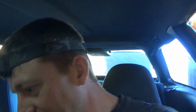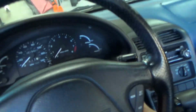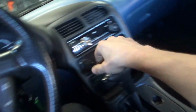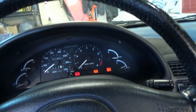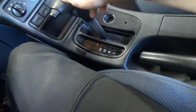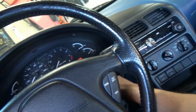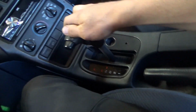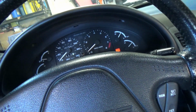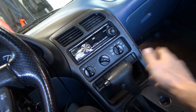And then it got so bad. Let's start it up and put it in gear. And it doesn't want to crank in park anymore. I don't know. In neutral, it's fine. I'll let it warm up a little bit. Boom, it's stalled out in reverse. And drive. It stalls right out. So let's unplug the TCM and see what it does with that module unplugged completely.